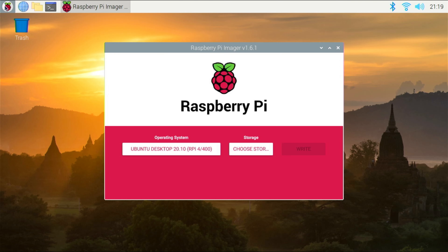Now I'm going to shut down the Raspberry Pi and remove the micro SD card. We now have our SATA M.2 drive flashed with Ubuntu. Once we get this assembled, we're going to take our USB connector and plug it in. When we reboot the Pi, it should recognize the M.2 drive as the boot device because it is plugged into the USB port, which connects to the Raspberry Pi 4. If you are using an external SSD with an enclosure, make sure you plug it into the bottom USB 3 port. We're all plugged in — let's boot the Pi back up with Ubuntu.